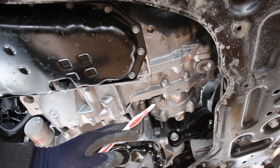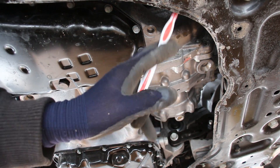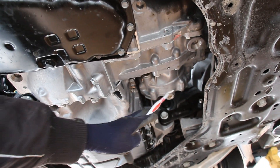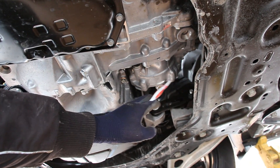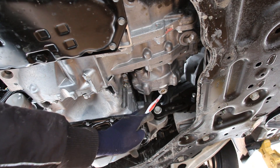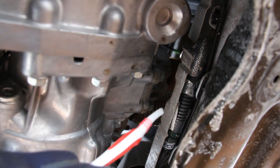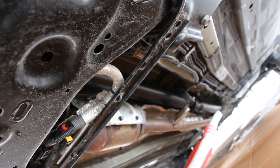Now the real reason we're here is because this Altima has all-wheel drive, which is new. Inside of here we have the differential for the front wheels that go out to either side. And then at the back here we have this transfer case which will transfer some of that power through the drive shaft over to the rear wheels. We have the fill port and drain port for the transfer case oil over here. Now that transfer case is going to rotate this flange here which will then turn the drive shaft all the way down to the rear differential.